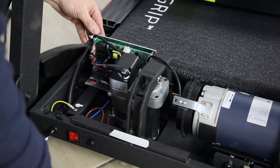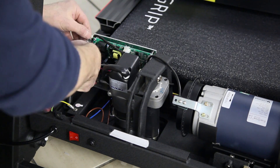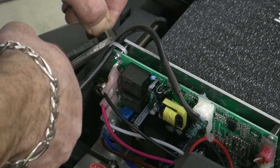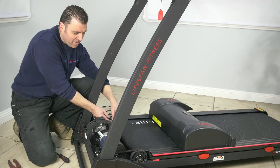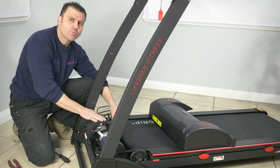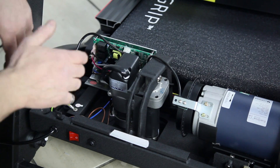You will find your lower control board on your left. You might have to snip a few little cable ties just to gain access to the wires. You will find a series of wires — some have plugs which can only go in one way. Some are colour coded, some aren't, but you can't mix the plugs up, which is a good thing.